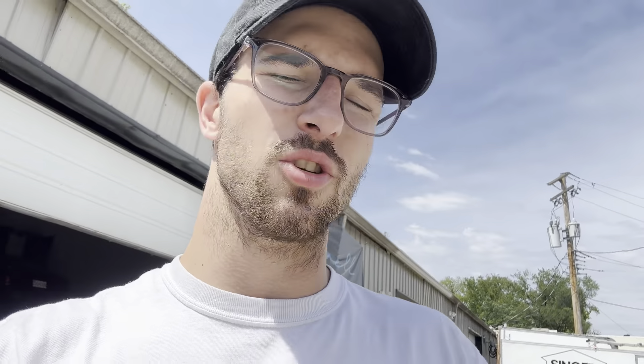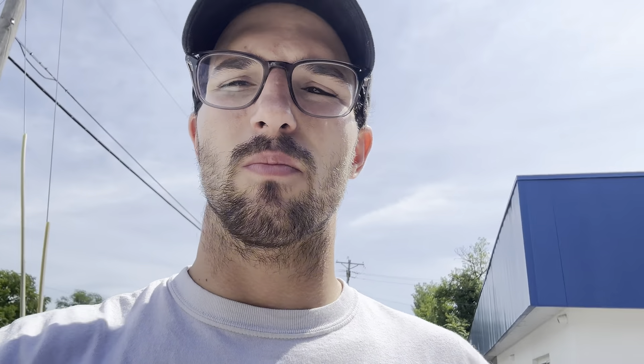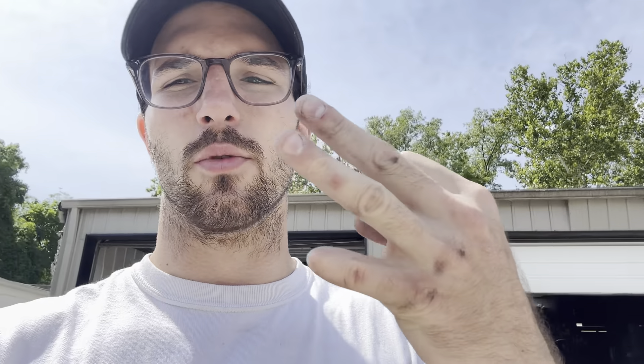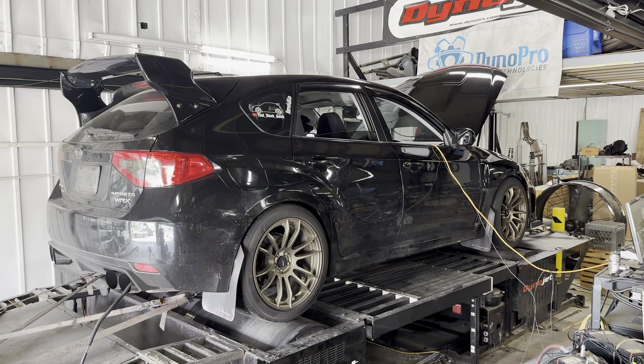It's safe to say I'm going to have a 350 horsepower Subaru by the time we leave today. The coil packs are going to be our main issue — there was way less smoke on that run. It's just a very faint misfire, not registering a code, but you can see it out the exhaust pipe. So I'm probably going to look into getting new coil packs and a three-port boost controller to help regulate boost better. Also need to run one step colder plugs, gapped about 0.026–0.028 — which is normal for Subarus. Get better ignition coils, a three-port boost controller, and come back for another revision to hopefully make a little bit more power.